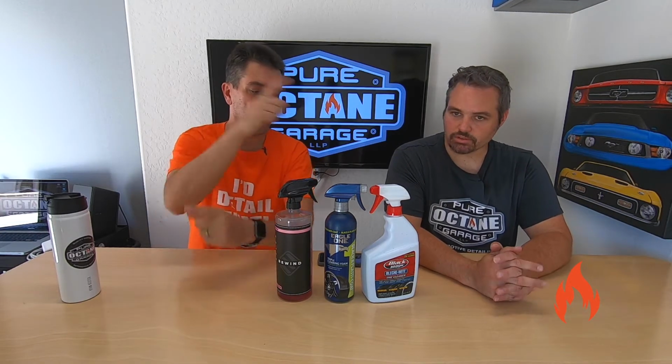We're kind of moving backwards here. So we start out by washing the hood with a good wash that doesn't have anything in it, a base soap. For our hood purposes, we just use basic car soap, no waxes or anything in it. Now for your vehicle, a better option is what's called a strip wash, or reload wash, I can't remember. There are a lot of names for them. There are different brands of good strip wash, and the benefit of those versus using some sort of dish soap, which you can, is that strip washes generally don't dry out your trims and the rubber seals, because a dish soap will extract the oils from those.